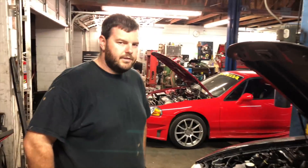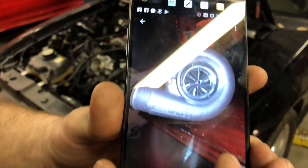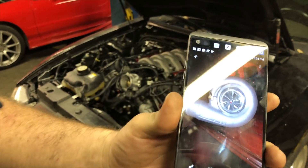It's coming along, dude — it looks good. Coyote swap, turbo, new edge, with the auto. Did you see the picture of the Precision? Yeah, I did — let's show it off. I wish I had it with me, but we can see it right here. Precision turbo — what size is it? 71-75, 0.96 AR. She's a big boy. Billet wheel.